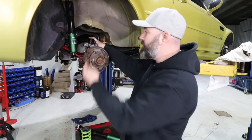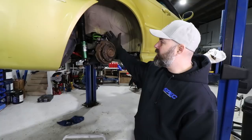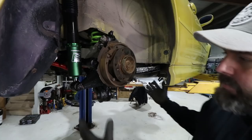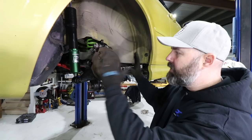So it's a little more complicated to use than a true coilover setup. Just like that, the Fortune Autos are installed on this side. We still have a bit of work to do — setting the preload on the spring and shock length, as well as setting the adjustment for the PowerFlex rear arms and alignment adjusters. We did torque these all down to spec, and we'll do a proper alignment at Racket Envy Auto. For now we want to get everything bolted up and in place, then come back to adjust ride height and other details later.